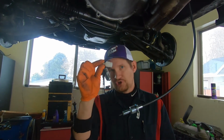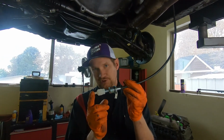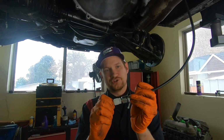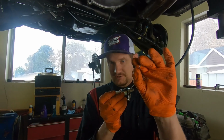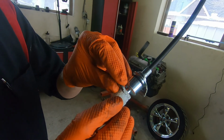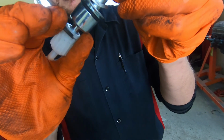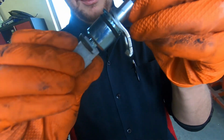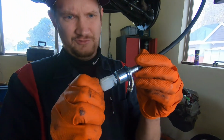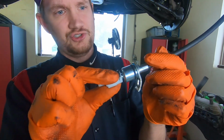Okay, so now that we've determined the right gear teeth for our speedometer driven gear, we can now install it on our cable. So it should go on, should be able to turn nice and freely. You can also get new clips from National Parts Depot as well. And we're just going to install the clip. Okay. It should just retain like that, turn freely, and shouldn't come off.